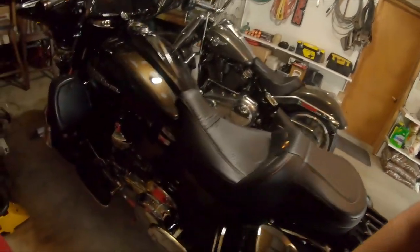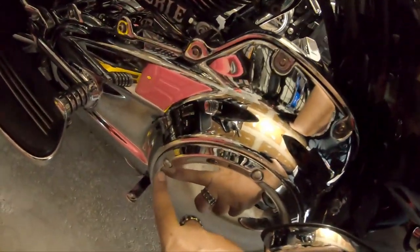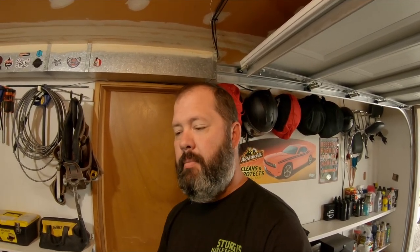Everything was going great, got all the fluids drained. Because I've heard the stories and I didn't listen, and it finally happened. These little bolts that hold the derby cover on — they're tiny — and I had one of the heads strip out. Fortunately I was over at my brother's dad's using his lift table, and he and I were having a good time, having a couple of drinks getting it done. When it stripped, fortunately he had what was needed. We drilled it out with like a 5/32nd, hit it with an easy out, and out it came.